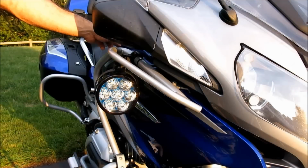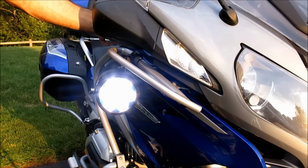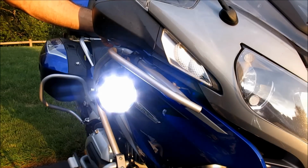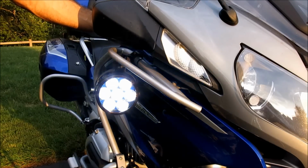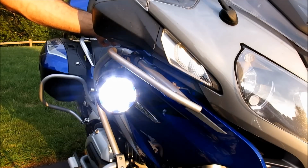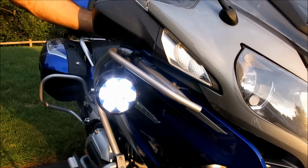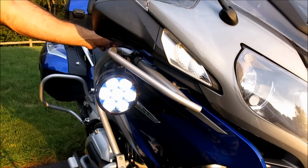The CAN opener also allows for automatic dimming based on pre-programmed thresholds in real time, using data from the bike's onboard photocell, and ties into other functions like the hazard lights, the high beam, and the horn for even more customization, all using the stock switchgear. These abilities are what differentiates the Sevinas from just plain old lights. All of the features I originally loved about the Darlas and Ericas are present on the new Sevinas.